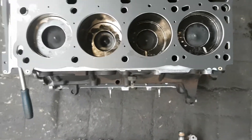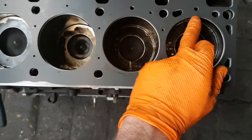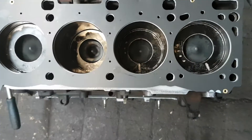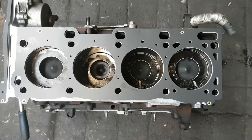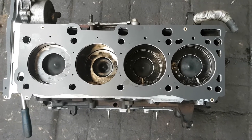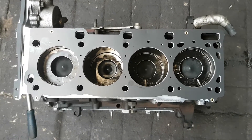The bottom end — a little bit of oil round the outside rim of each piston, a little paintbrush, turn the engine over a few times, wipe off the excess, wipe the surface clean with a solvent like thinners or something, dry it off, make sure everything is spotlessly clean, fit your gasket and then fit your cylinder head.